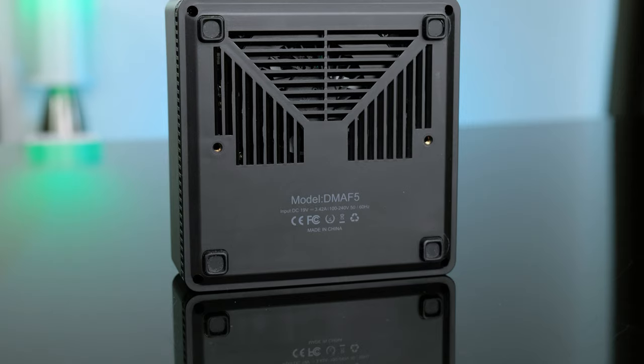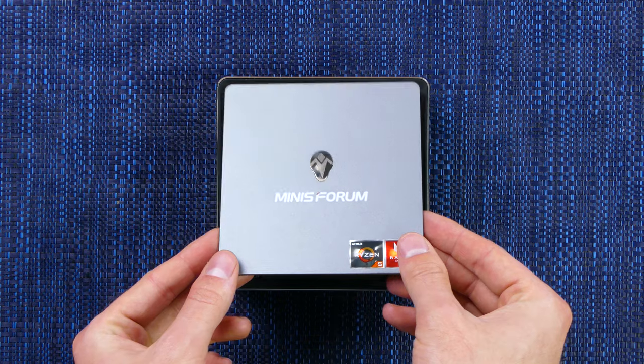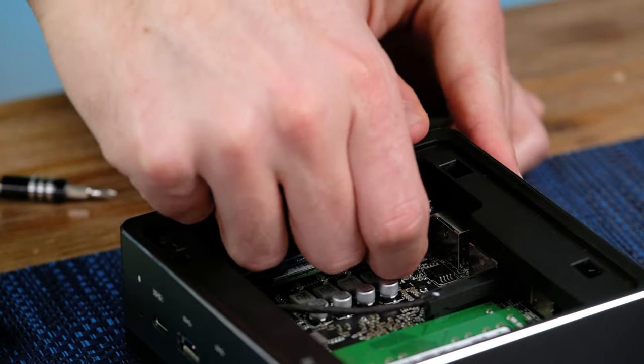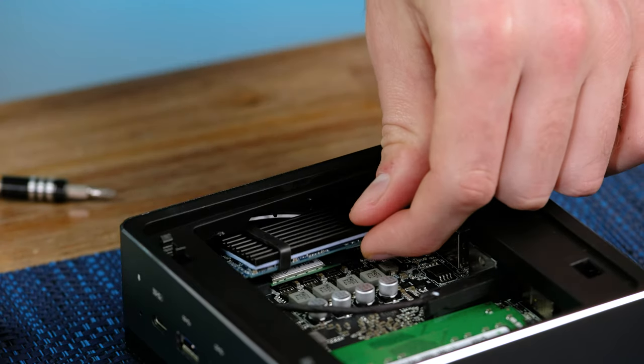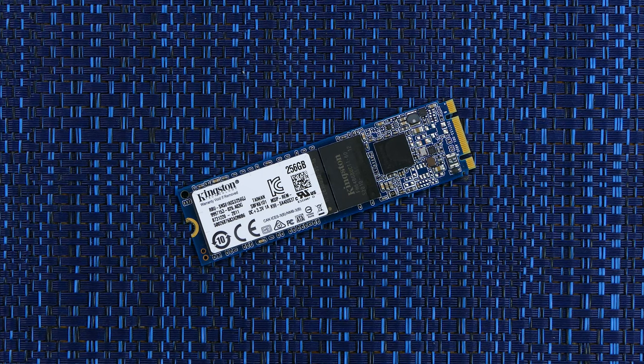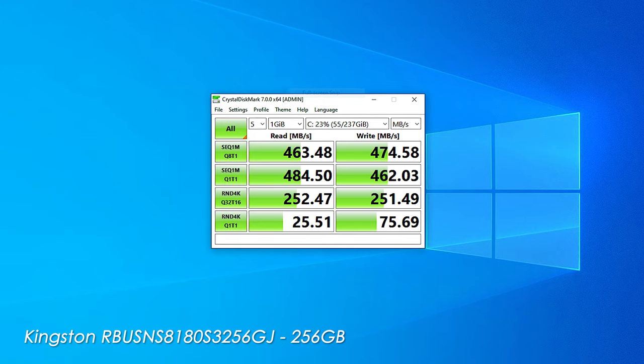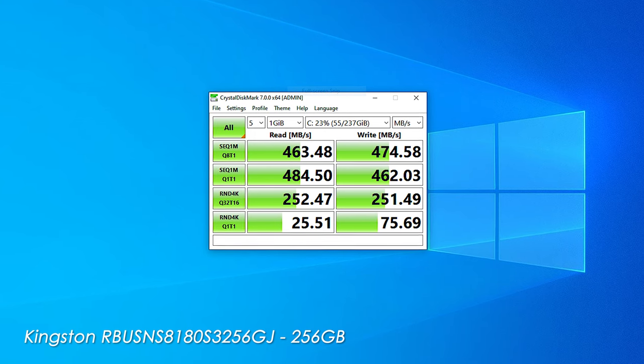But what's it like inside, and is it easy to upgrade? All you have to do is push down on the top lid and you've got access to all of the upgradeable components. In the M.2 slot, we're given a full-length 2280 solid-state drive with a heatsink — something I've never really come across before. After removing the heatsink, we can see it's a 256GB Kingston drive. The SSD in the pre-production version is a SATA SSD; however, the final version is apparently going to come with an NVMe PCIe Express SSD. Even the SATA SSD that came in the pre-production unit was pretty fast and had really good read and write speeds.